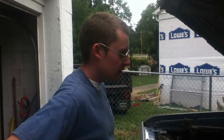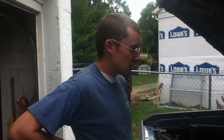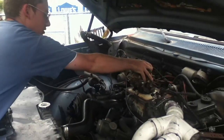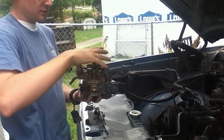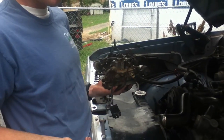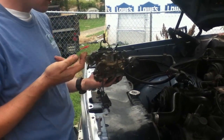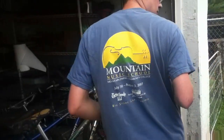Hey everybody, Chris here with the wood gas truck. I've discovered a new, better way of carbureting my engine — getting rid of this old carburetor, at least for test purposes. As you know, carburetors are filled up with gasoline and they mix it with air going into the engine, but when you're running on wood gas you don't need the gasoline. Unfortunately, it's very hard to seal it up so that there's no air going through. So I've got something that seals a lot better.